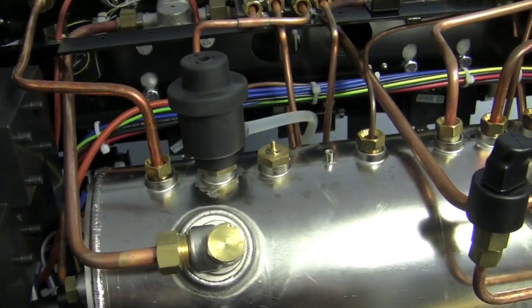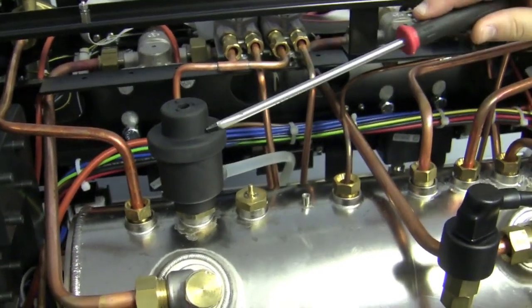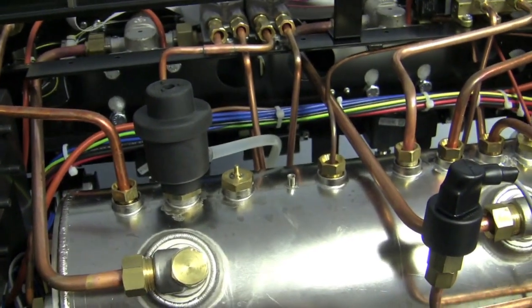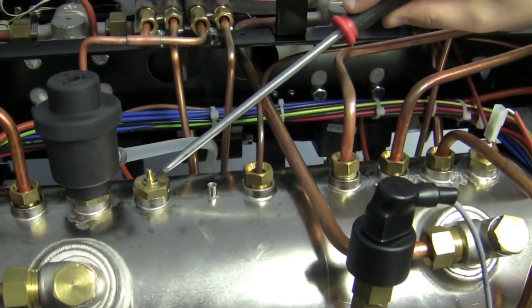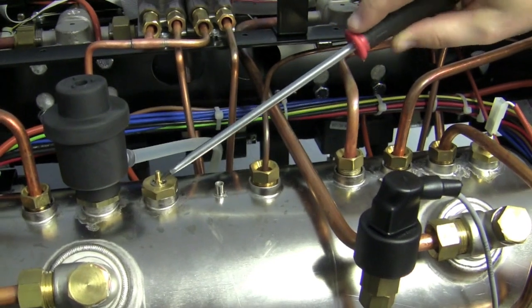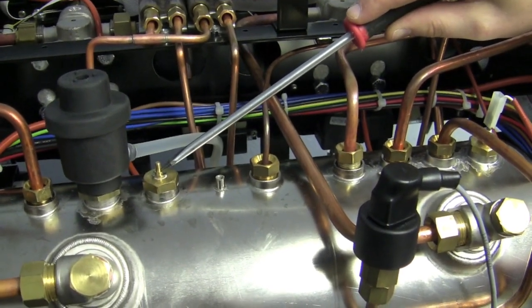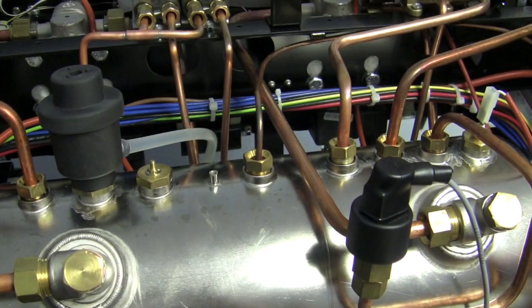Going kind of left to right — this is our safety valve. This is what saves lives. If anything goes crazy and your boiler heating element just stays on, this is going to spray everywhere and stop the steam from building — it's going to protect you. This is what's called your anti-suction valve. We have no steam inside of there right now; if there was steam it would be up. That equalizes the pressure so we don't have any type of negative pressure or anything sucking back.